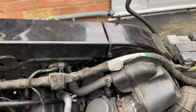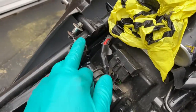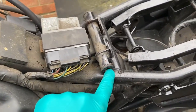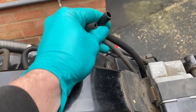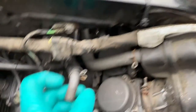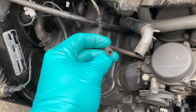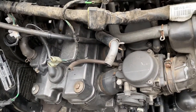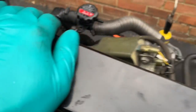I've also removed the tank — that's just two bolts, the seat comes off and then it gives you access to a big bolt here. You undo the nut on this side, the bolt slides out, and you've got four pipes under here: two on the right hand side, a bigger one on the left hand side that goes to the fuel tap, and a vacuum pipe as well. So four pipes, one bolt slides out and then the whole tank will slide off these rubbers.